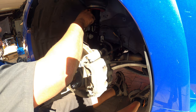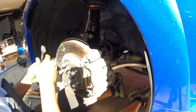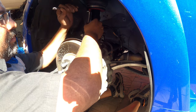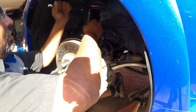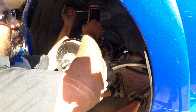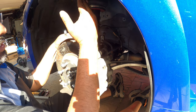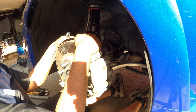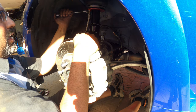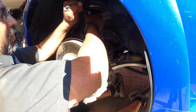So thread the line in by hand, just a little bit. You need a 15 millimeter wrench, and since it already has a sealant on it, just tighten it on. Now these are MPT, I believe quarter inch or half inch MPT lines, so they automatically start tightening halfway through. No need to go all the way down. Once they get really, really snug, just give it a nice little tug and you're done. They're not meant to go all the way down. They taper pretty much on the way in.